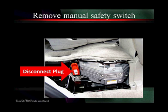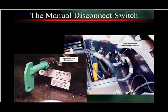Do not confuse this with the new two-mode GM hybrid. This is the newest two-mode, which is more like what we're going to be talking about with power splitting, but it's power splitting plus direct connect. This has a quick disconnect that is different — it's a manual disconnect where you turn it. It's buried down there and it's going to disconnect and turn the system off.